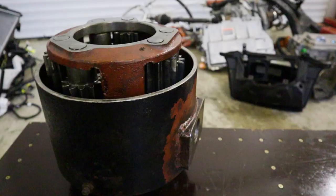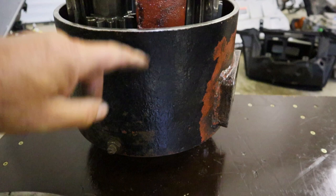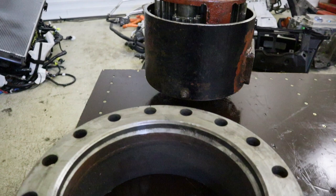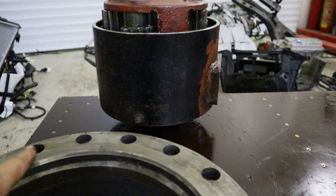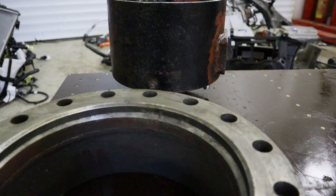It's secured in the proper position over here, the differential in the tube. And now we have to cut this tube in a way that this differential will be about 23 millimeters below this point, somewhere like this over here. So we have to make the measurement really, really precise because there is no room for error. It must be exactly, I think, 23. I will take a look at what I wrote before, but that must be the exact distance. Otherwise, it will probably not work in the truck if that measurement is not correct. Let's go.